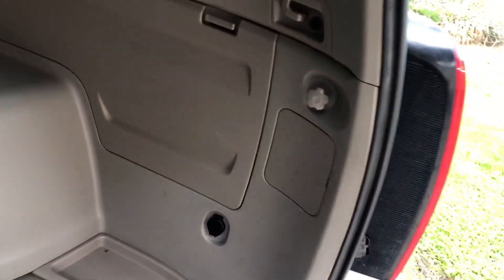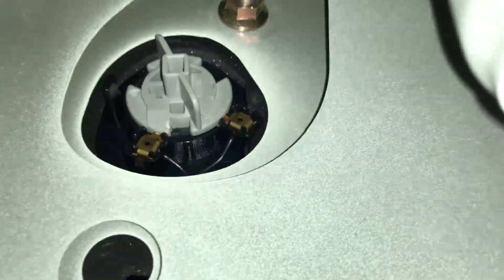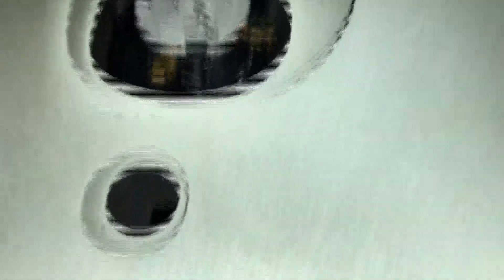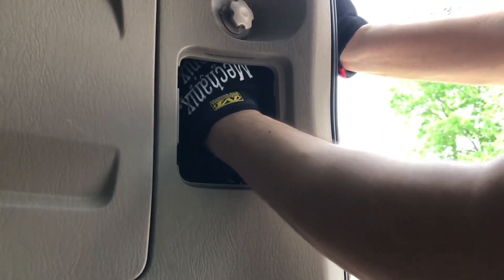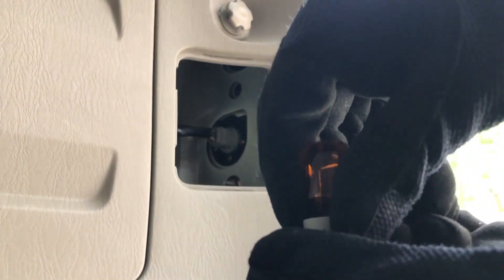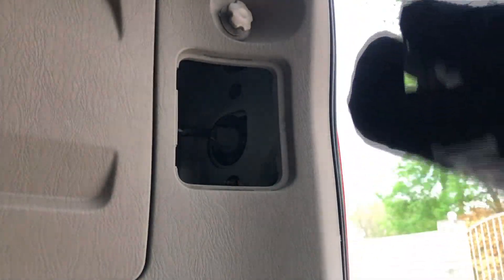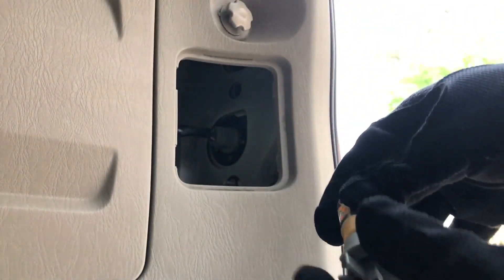The trunk is open and I'm going to start with the passenger side. There's a panel we need to pull out, so I'll get my prying tool and pull it out. Looking inside: at the top we have the turn signal — that's a cap. In the middle we have the brake light which is a wiring harness, and at the bottom is the reverse light which is also a cap. We're focusing on the top one — all we need to do is turn it counterclockwise and pull it out. Take the incandescent bulb out, take the LED bulb, slip it in, and put it back in the socket.